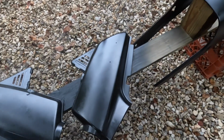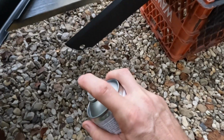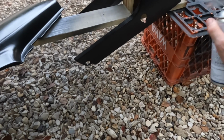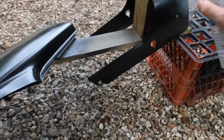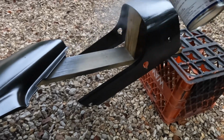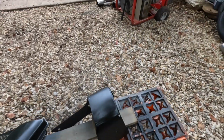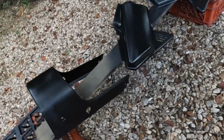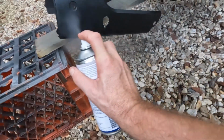We sanded this with, we ended up, because we had stripes, still had the decals on it. So we ended up sanding it with, started with 220 grit sandpaper, and we ended up with 400 grit sandpaper. The next sand at 600, and then we'll work our way up.